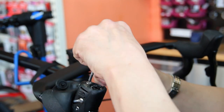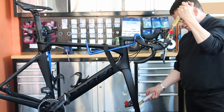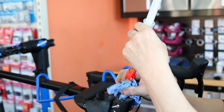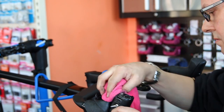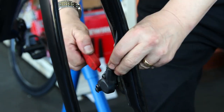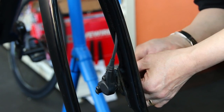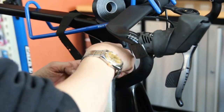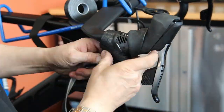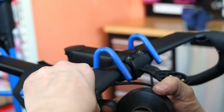As I put on the fittings I wipe them off to keep mess to an absolute minimum, and then we use the syringe system as recommended by the manufacturers to get fresh fluid in there. We had very little air in there the way we did the removal, so all we were effectively doing was pushing through fluid to make sure there was no air — it wasn't a lengthy procedure. I always put a little bit of copper slip on the end of the brake — that's a heat-resistant grease — and that will stop the piston sticking to the back of the pads. You'd do that on car brakes as well; it's a good practice to future-proof against problems.